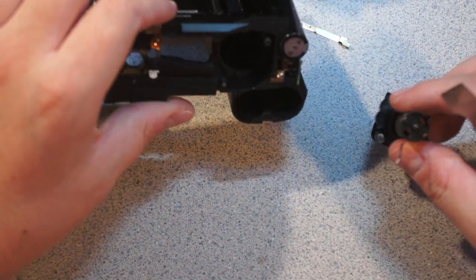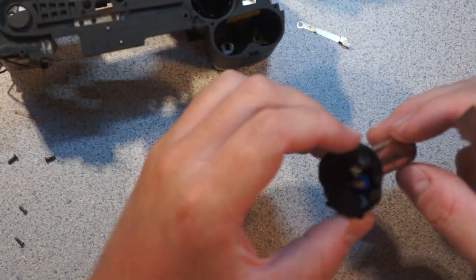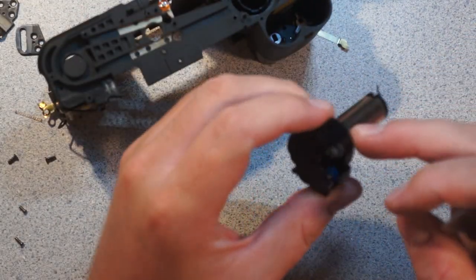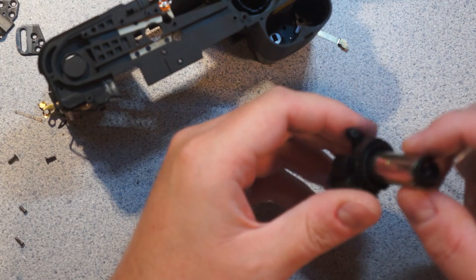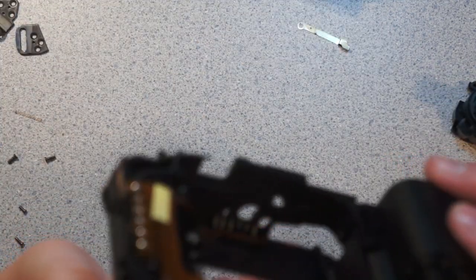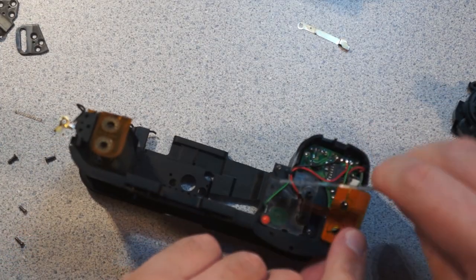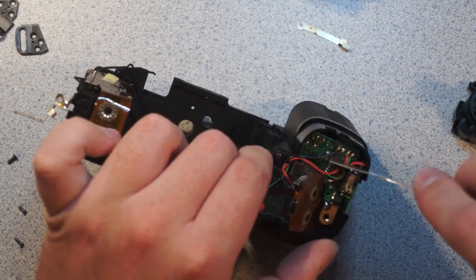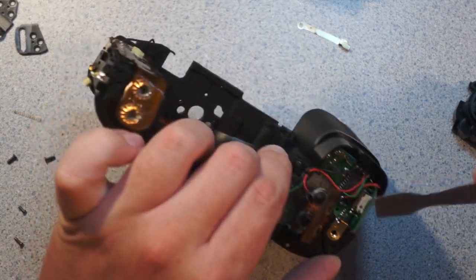Oops, correction. I was just yanking on the motor leads. So I was right, they are in fact using the center of the take-up reel as a place for the motor drive. That's quite clever. So how did those leads get in there? Oh, derp, they just go right down here. So it looks like these are those two leads, and I bet that this is a motor driver chip of some sort.